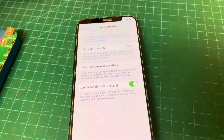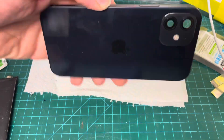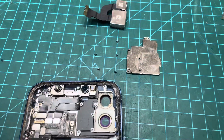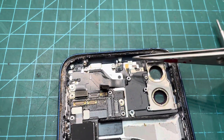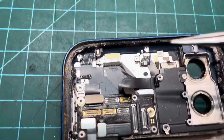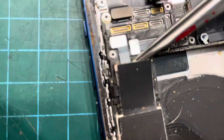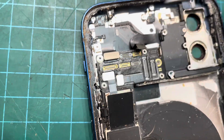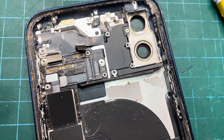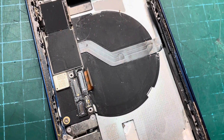I'm going to carry on now with restoring this iPhone 12. I've got to remove all of the insides and put them into the nice new housing. Those five screws remove the cameras. I'm going to move on to removing the face ID next. I've removed the face ID - there are a few little sticky pads on this bit and that bit, kind of stuck to the bottom of this ribbon here as well. Moving on, there's a pad here that needs to come up for the side buttons and the power button, and I believe it's also for the wireless charging. So it's this ribbon that runs here, and then we've just got a few screws and we'll take the board out.